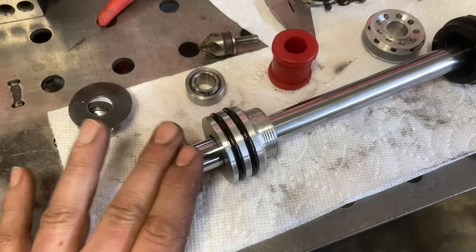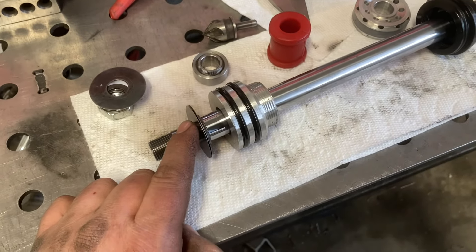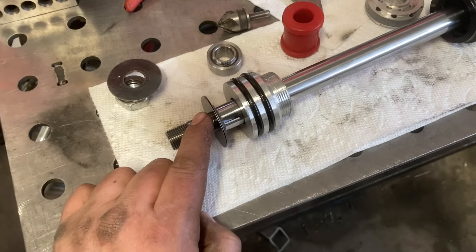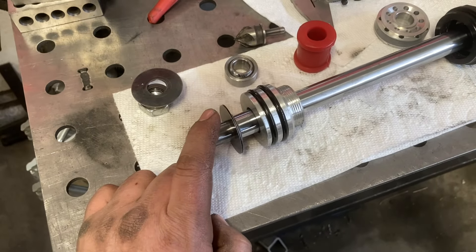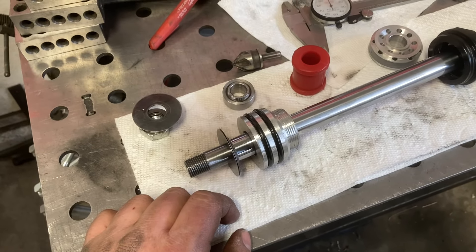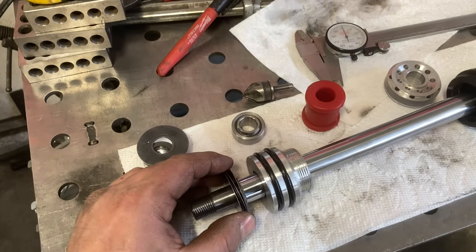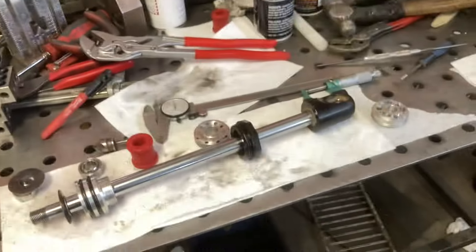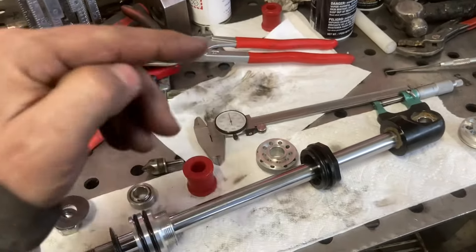I'm leaving the stack alone because the ride of the Samurai was generally quite good, especially driving it fast and hitting bumps aggressively. The place where it kind of suffered was small, small movements — like hitting expansion joints or something where it's a short square-edge bump.